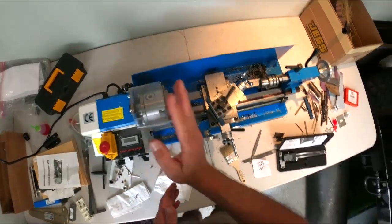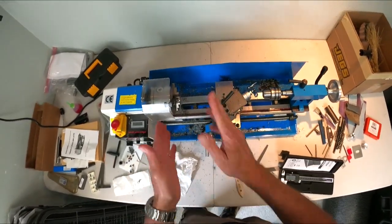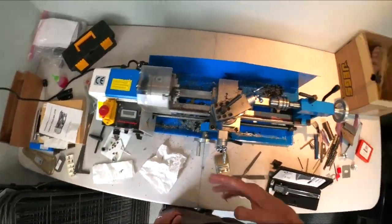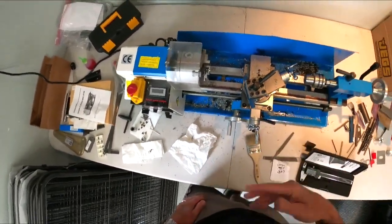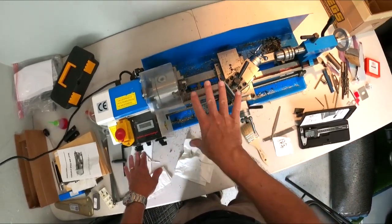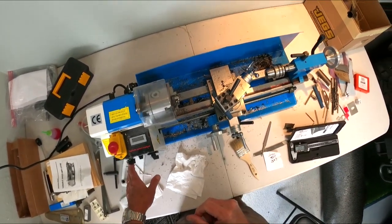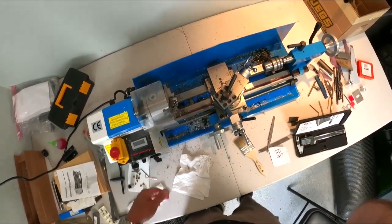I'm just going to face this off until I get to 367 thou. Sand both sides to make it nice and smooth and pretty. And then we got a bushing. And then this is going to go over and over again to make sure that we got ourselves what we need for the width. So I'm going to say that's probably good.